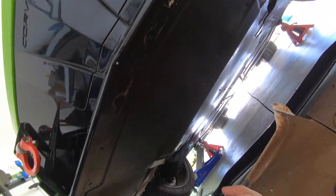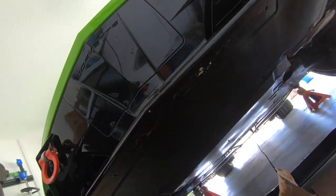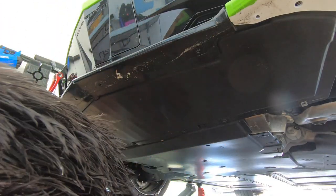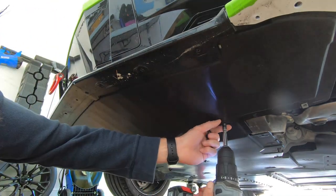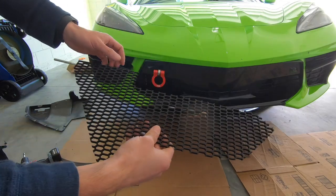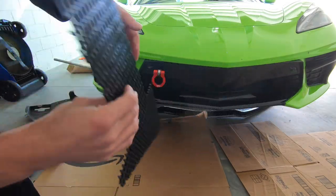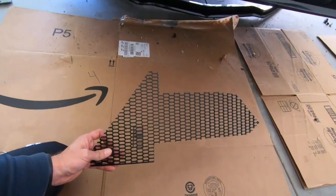They say you don't need the middle panel taken off, but it's only four bolts so I'm going to take it off just to get a little extra clearance. When figuring out which side the grills go on, one of the sides will have little pegs in the back — make sure that side faces the rear and the smooth side faces front.